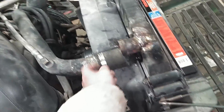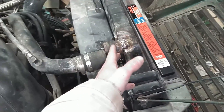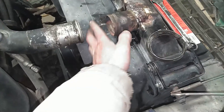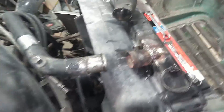Now that this is brazed, I think we should address the fact that this upper radiator tube does not line up to the outlet. I kind of hate to go cutting this apart and re-welding it to make it fit, considering if I go back to a factory radiator in the future I'll have to cut it and make it longer again — but I think ultimately that's going to prevent this problem from reoccurring. So we cut a little bit out right here, it's tack welded back together, and our inlets and outlets are now lined up. Because this is on an angle when I cut it, it moved it back a little bit too, which lets us use a slightly longer piece of hose and gives it more room to move around as the truck flexes, putting less strain on this filler neck. So that's what we want.